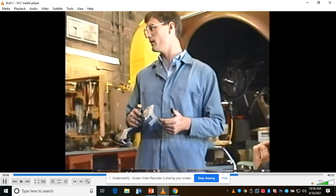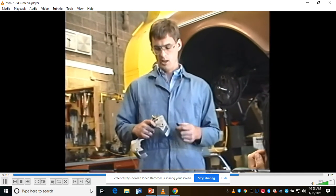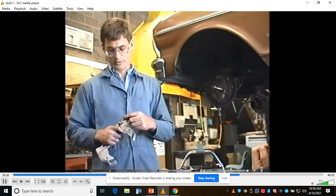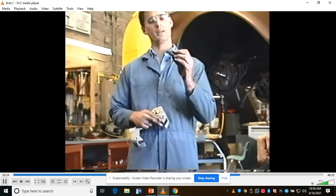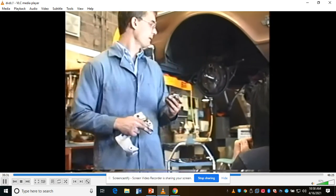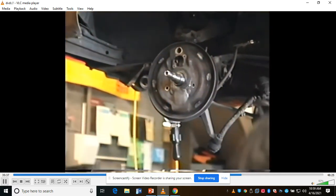There are stronger bolts, but of anything that you're going to find readily available, grade 8 is going to be it. If you make it grade 5 or grade 3 and something breaks, in a pretty critical application, you want the strong bolt. The only reason it's gold colored is that it's anodized; it looks nice. You'll notice the size of this old one is, I believe, half fine thread. This is 5/8-18 thread. So one of the things we're going to have to do, in addition to machining up the spindle, is drill it out and tap it for 5/8-18.